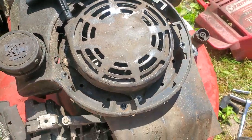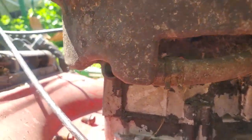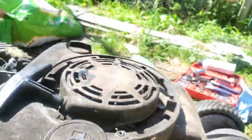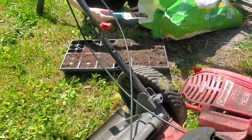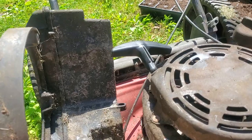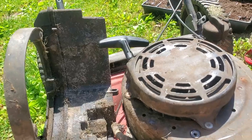On the side there are two bolts. You're going to take out the left side bolt — the right side is just like a heat shield or something. After you get that fourth bolt out, you're going to take the gas tank off and just set it aside. Hopefully you didn't just fill it up, which is not a big deal if you have a tight cap.